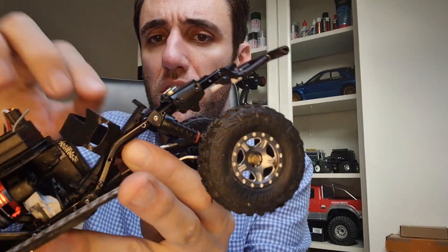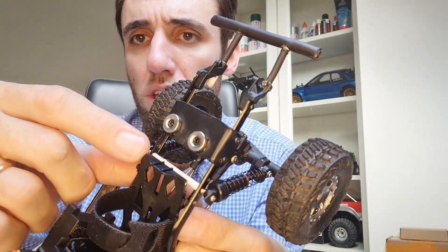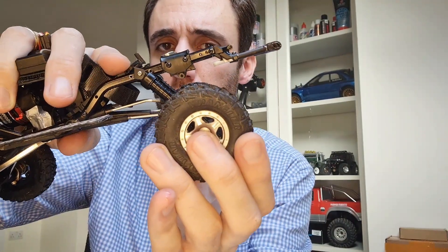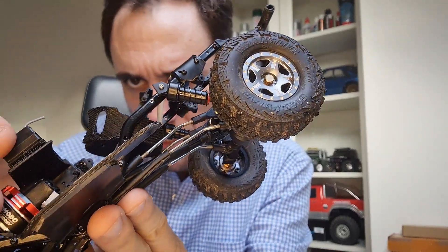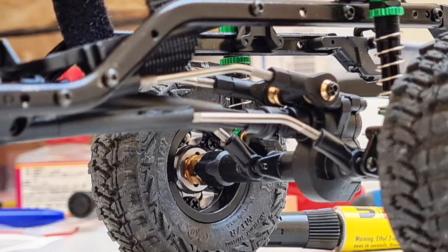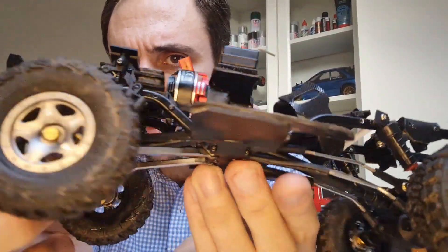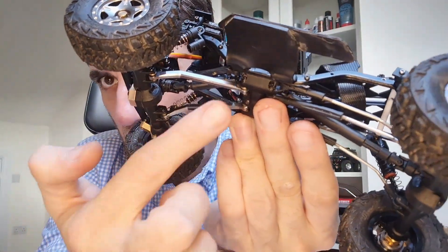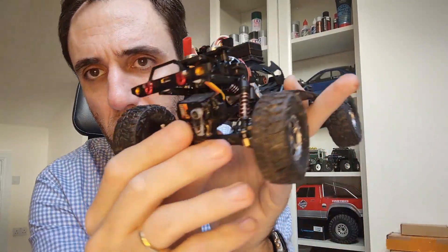After some adjustments, I made these custom drill holes in the chassis rails. I put this styrene rod here to tie the suspension up, and at the moment I feel it's perfectly fine. It has a lot of drop when I want, a lot of compression when needed, and it works very well with the custom clearance links I made using some rods and recycling some of the old links from another SCX24. I still need to improve that — this was my first version, kind of an experiment. In the front, the links are the same length as in the normal SCX24, and I'm using the same Injoras that I already have for other rigs. Nothing new at the front.